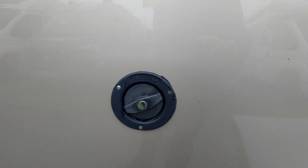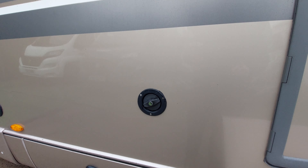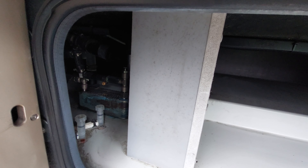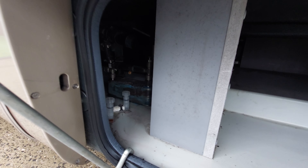The water will just unlock with the same key, allowing you to put a hose pipe in and fill up your water. There are a couple of drain points and I'll show you one of them inside for the freshwater tank. Lower down we've got accessibility to your underfloor — there are a couple of manual drains there. If you turn them clockwise it will stop water from coming out; anti-clockwise will allow you to empty it. If you've got water coming out from underneath the pipes, that's where it's coming from.